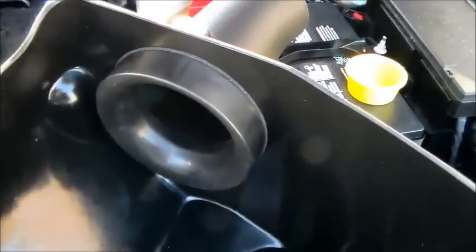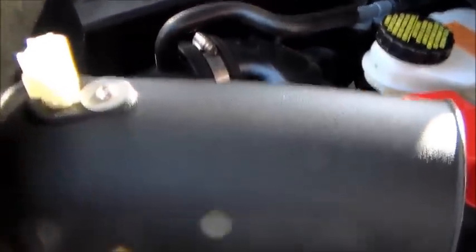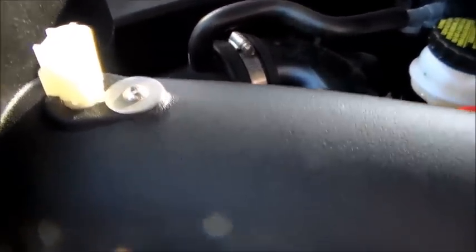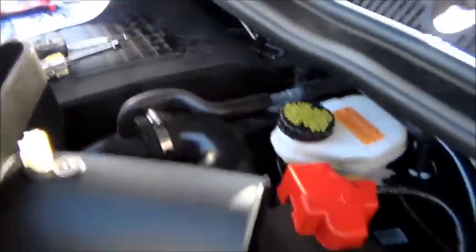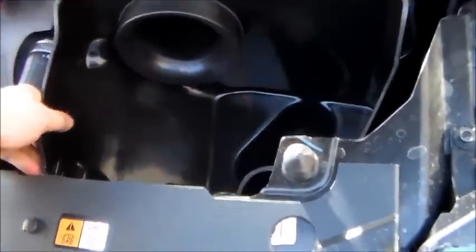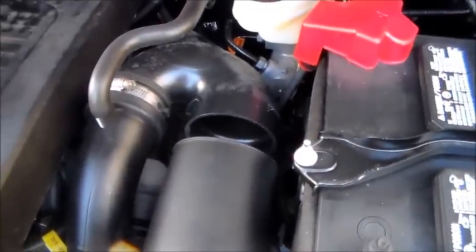We've assembled the air box — really not rocket science. That velocity stack is pretty nice; it just bolts on with three 10mm bolts. You have to transfer the air temperature sensor. Ford uses a nice rubber o-ring on it — you put it in and it twists in place. The Airaid housing is a really nice snug fit, it's clocked, and then it uses a 3/32nds Allen bolt and a stainless washer to hold it in place. Then to fit the box in, it nicely goes in and you just give it a little twist and it will eventually drop into place. I should have put that hump hose in first — I'm not following the directions.